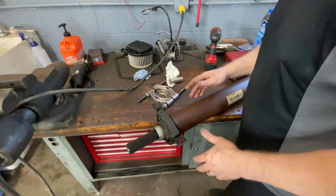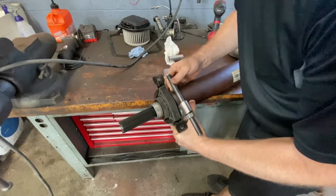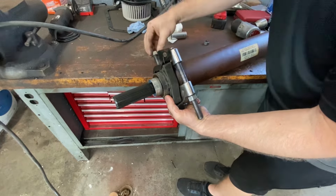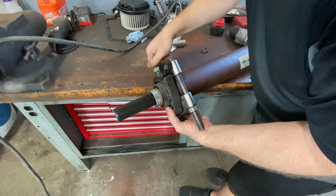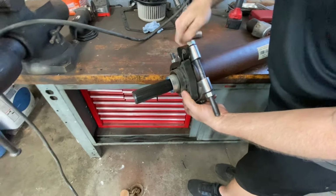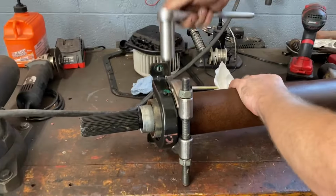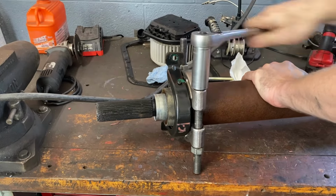I'm gonna have to do a voiceover here. This has been happening on the last few videos where my wireless mic, I don't know if it's draining my battery or something's going on here, but nonetheless, what you see me doing here is using a bearing separator or bearing puller. You split it in two halves, and it has a taper. So I'm putting the taper side down towards the rigid shaft. Once you start clamping this together, something's got to move because you're pinching something in between the two pieces. So the hope is that something will start moving, and that's going to be the bearing. Once you get this to start moving, you could put it in a press, or there's also some adapters that you could screw into this bearing separator. But I'll be taking it over to the press here shortly, and I do apologize because my battery dies, and that's something I'm going to have to start looking into to see why this keeps happening.